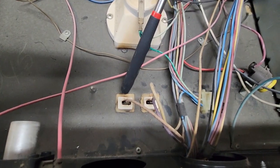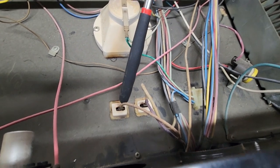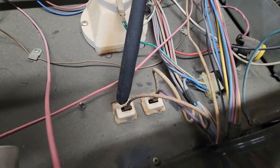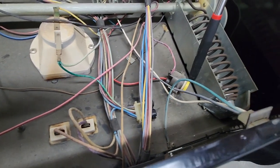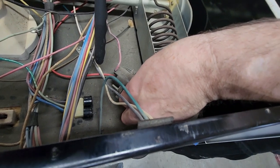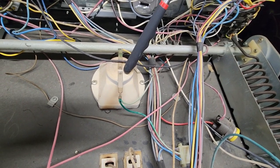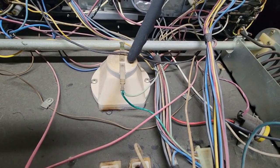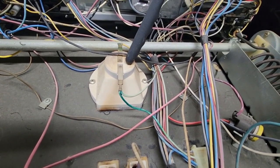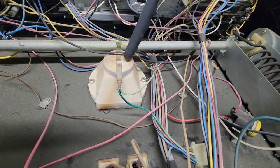This is a really good view of the top of the broiler. Look for burnt wires here — they'll be discolored, but not necessarily burnt. If you touch one of these and it falls off, that could be your broiler problem. This is a very common spot for burnt wires. The two wires for your broiler are here. This is the screw-in, screw-out fuse for your speed heat burner. This holds your oven bulb — this is your ceramic oven bulb holder.